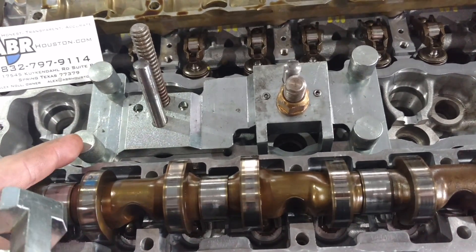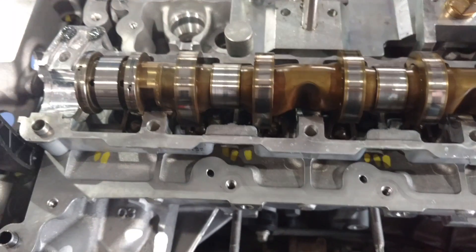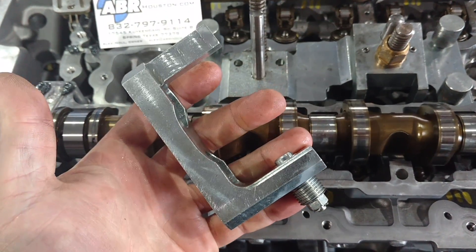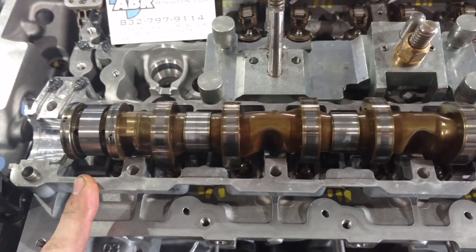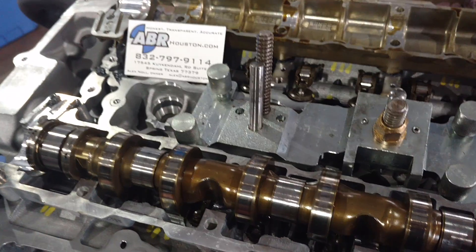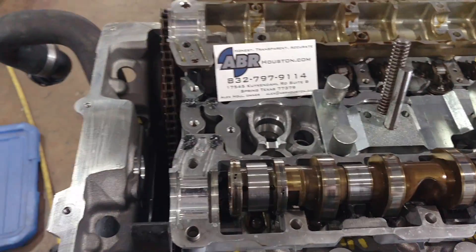Sometimes you could damage the camshaft as well. This big tool physically pushes down a set of valves to let the camshaft naturally sit flat. Once we put the cam in the tray, we'll put the cover on top, properly torque our tool to align everything, and then replace the bolts and torque it all down. If you have an issue like this, it is not for the faint of heart — there's probably around seven or eight hundred dollars worth of special tools. Cam timing is very important and if you get it wrong, you're going to hurt the engine, so it's best to leave things like this up to a professional.